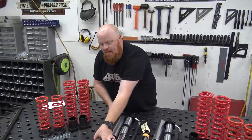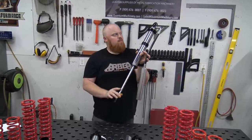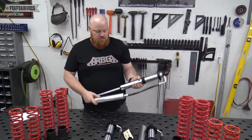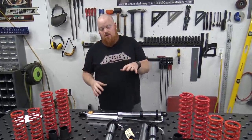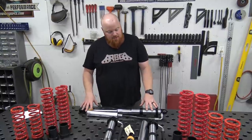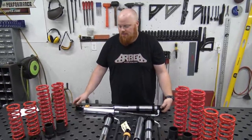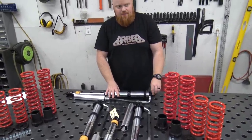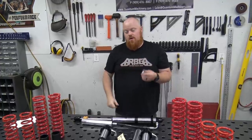I've already got the shock extended out. I paid extra to get the 90-degree turns going to the reservoirs and for the bump stops — I think that was about $15 a piece extra. Originally we used those Monroe helper coilovers — they weren't designed to be standalone coilovers, but they were really good to mock things up. It turns out FOA basically built these shocks exactly the same length as those Monroes, same diameter, and they actually have heim joints in there. They come with high misalignment spacers and once I put the spacer in each side of the tabs it's the same thickness — completely custom for this buggy.